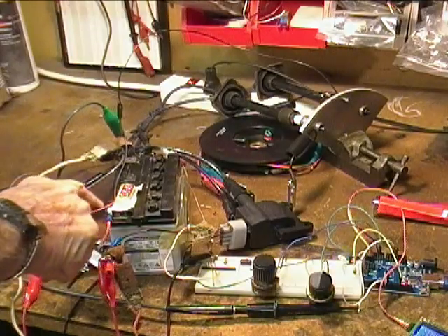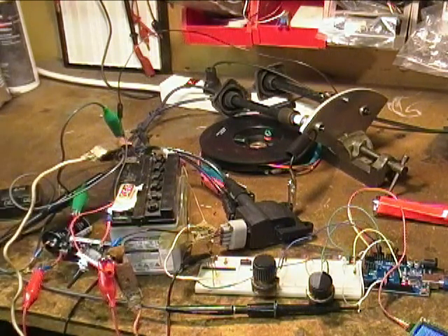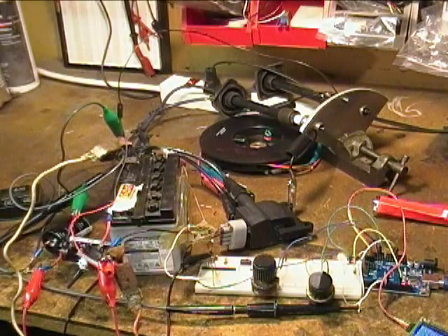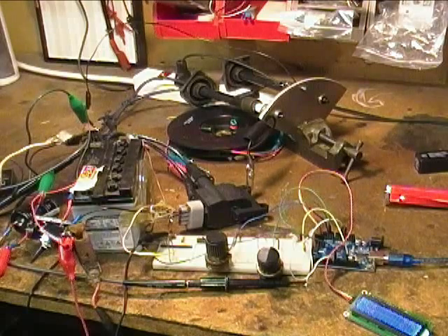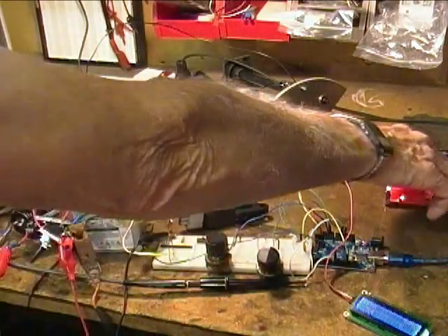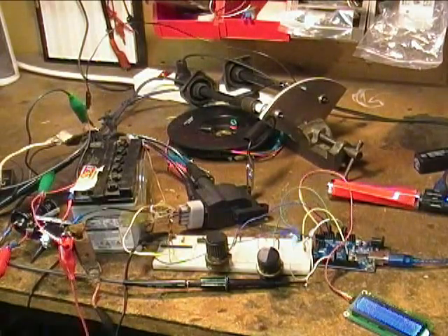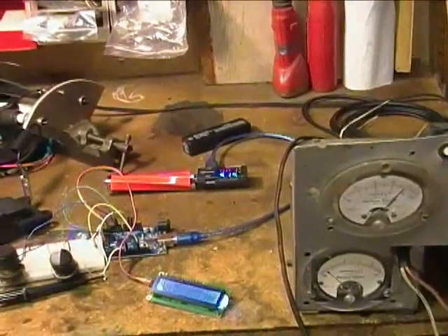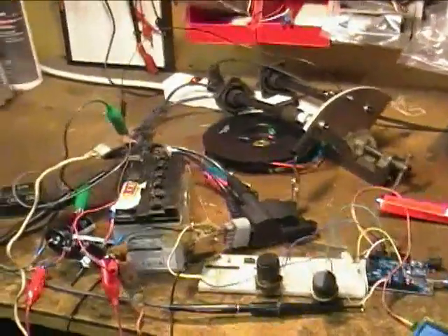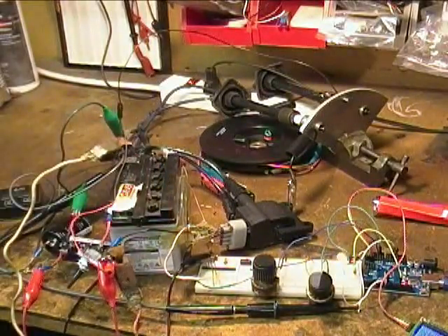Note the little power supply meter sitting on top of the garden tractor battery — that's how I keep track of the voltage applied to the coil. To do the testing, I simply plug the UNO in, plug my power supply in, choose a voltage level — which I can see here is about 13 volts plus or minus a little bit — and then start taking data.